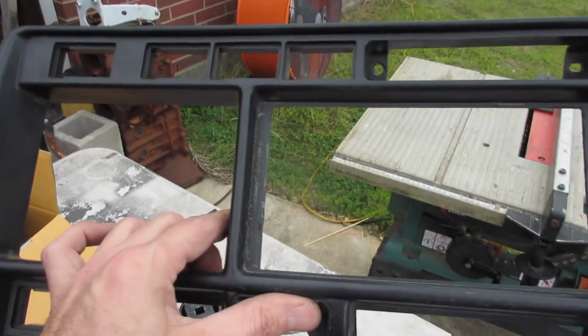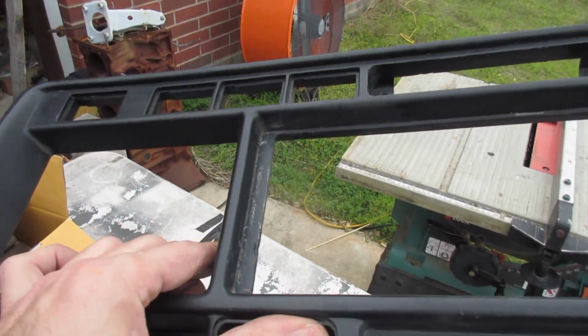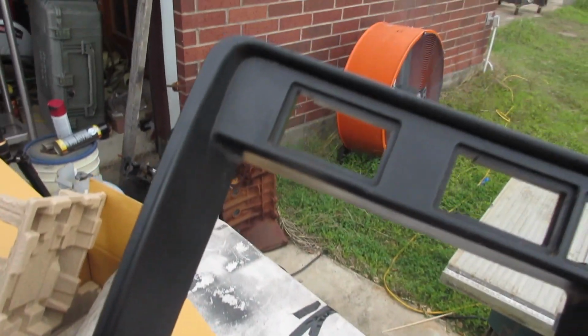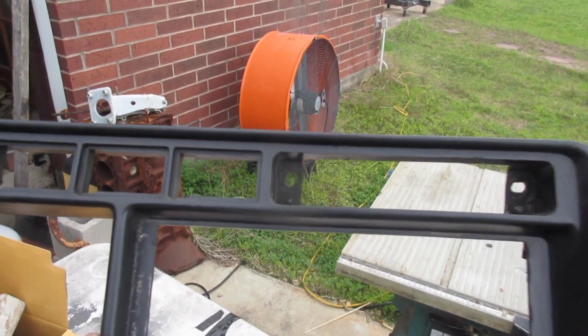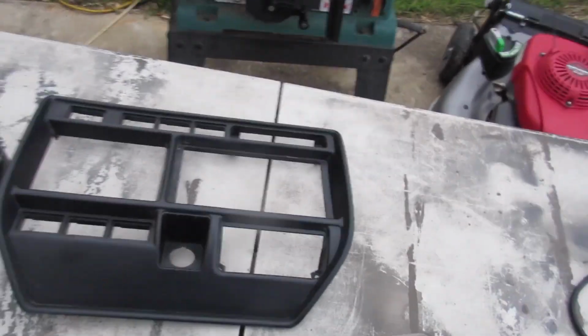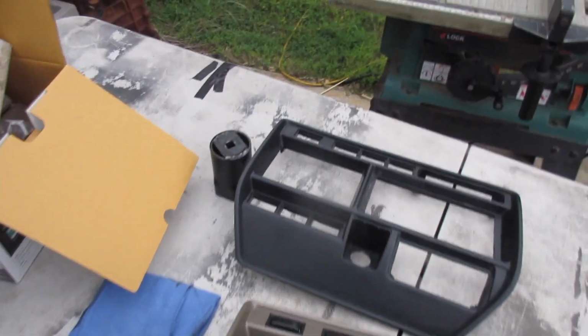The other thing that sucks on these 80s is when you pull off that wood trim, like this one, you can still see the goop there. Wait for a 100-degree day and then pull it, and hopefully all the stickiness comes with it, because if you do it in winter, you're going to end up with a bunch of crap. You're just going to sit there all day trying to chisel it off.